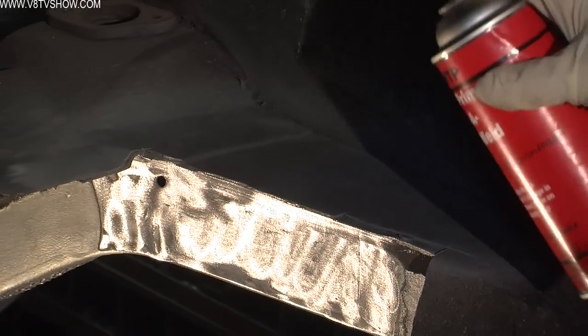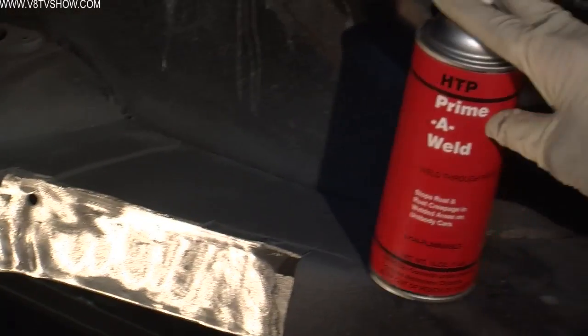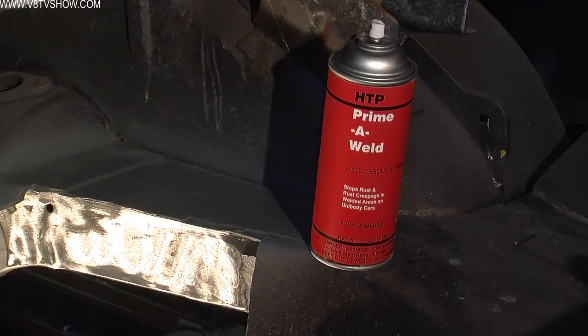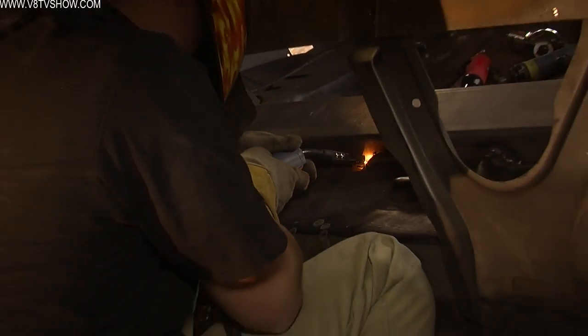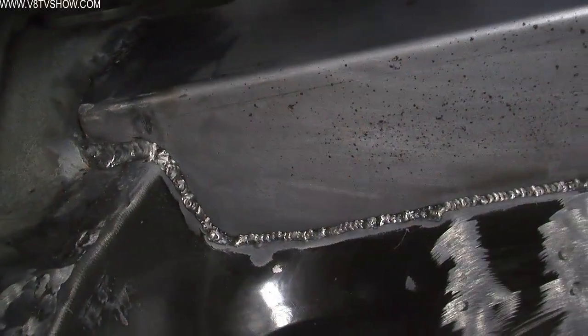The pocket is there because as the Detroit Speed rear suspension system articulates, the upper panhard mount would actually protrude into the Camaro's trunk floor. So this provides a clearance area so that you don't have any contact points. Again, this piece gets welded in all the way around. Nick took some time to MIG weld small sections at a time so he didn't introduce a lot of heat and warping into the trunk floor or the Detroit Speed panel, but it's just a matter of taking your time and going around and making clean welds.